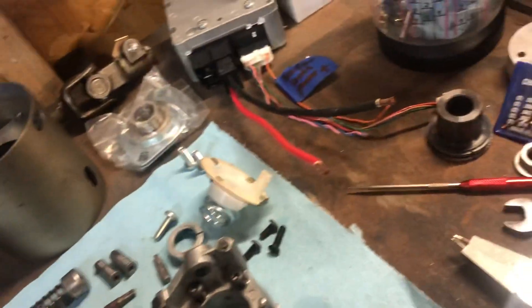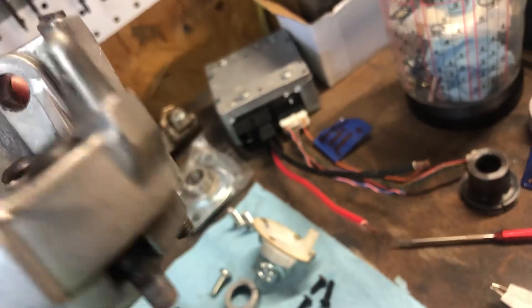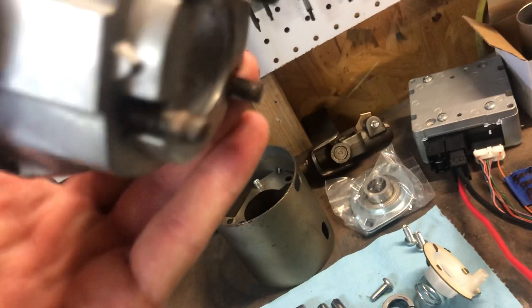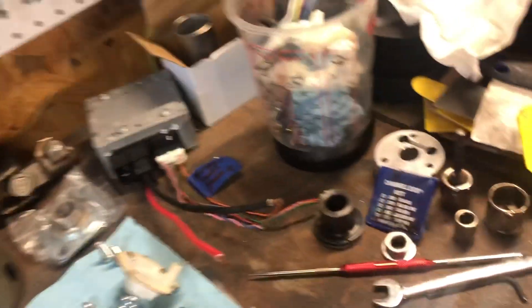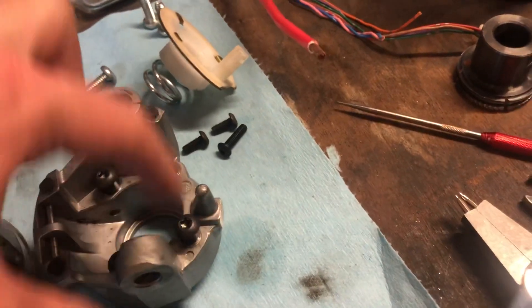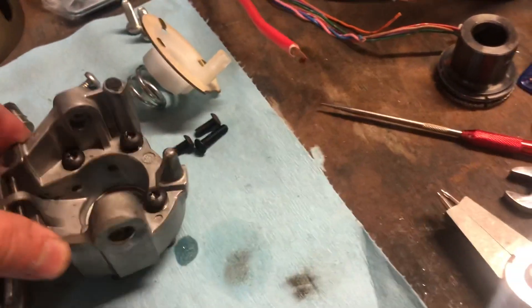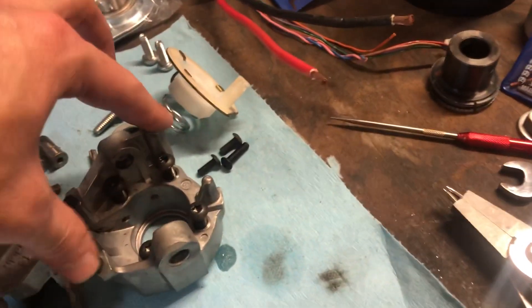If you have a tilt column, you have this piece. You don't have to pull it — I pulled it because I'm powder coating and it's greasy. Be warned: these screws are red Loctited. I didn't know that when I pulled them, so hopefully I didn't tear up threads. The folks on the I Did It forum told me these screws didn't need to be touched but failed to mention the red Loctite — you'd want to put heat on them first.